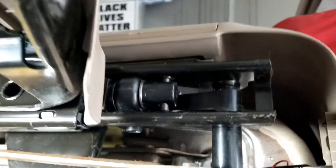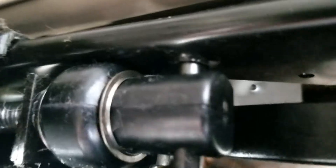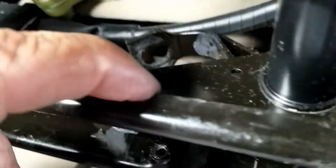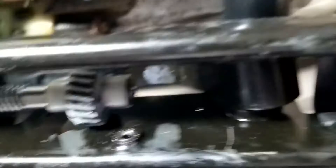At the end of the motor — and I'll show you this — this is the inside of it, but this is the outside. You can see the worm gear back here. There are two silver rings, one on each side, that hold this together. When you take these two rings off, these two halves come apart. Now there is a pin that goes through this end, and you have to use a small punch and knock that pin down out of the transmission case there and then out the bottom. That gives you some access on the top of the transmission.